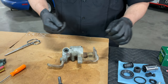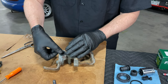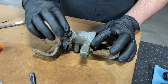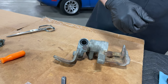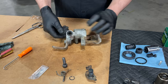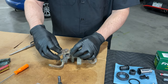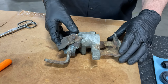Now we're ready to install the oil seal — or grease seal in this case. It fits right there. You can actually use a socket that's about the right size to press that seal into place. I can press this in by hand. It shouldn't require a lot of effort, but it also shouldn't just flop into place. Now that I have this pressed in, I can actually install the arm for the parking brake actuator in its home — carefully slide it down into place, and that part is ready to go.